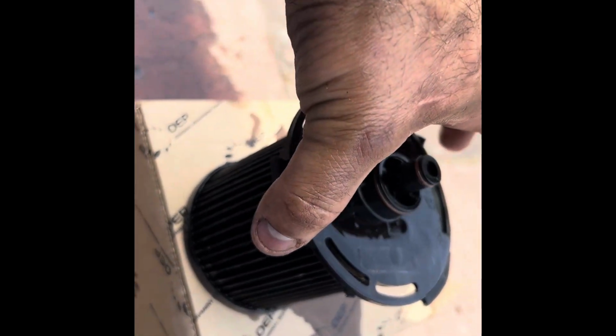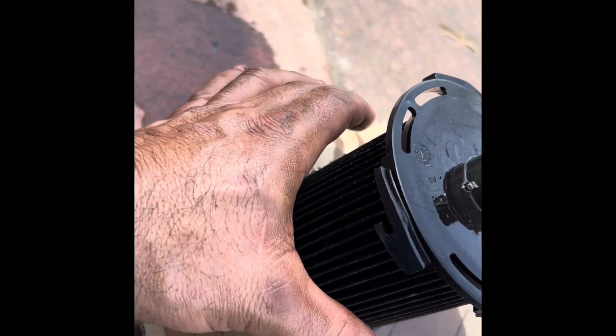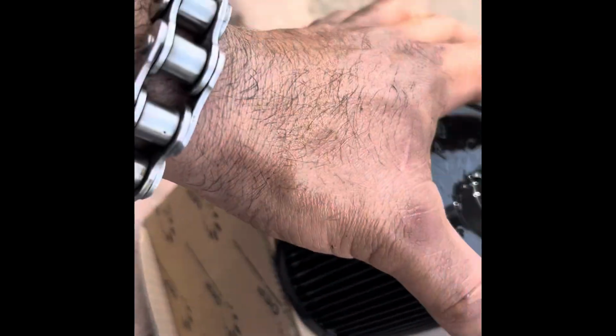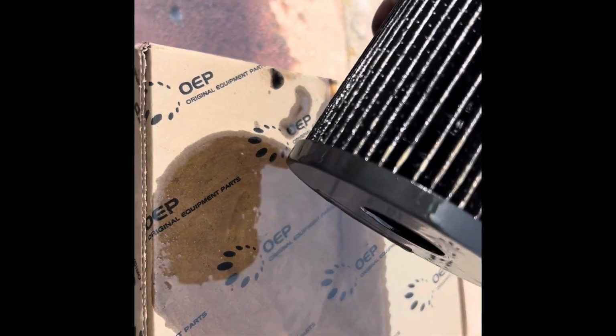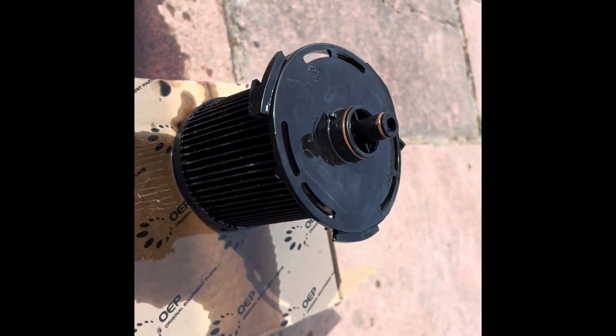So what you do, to put it back on, is you fill the tub, the cowl in, half full of diesel, you fit that into the cowl in and lock it in, and then the entire thing goes straight up and locks into the van. But as you can see how bad all the particles are on that. So it did need changing. So that's how you change the fuel filter on a Mark 8 Transit.